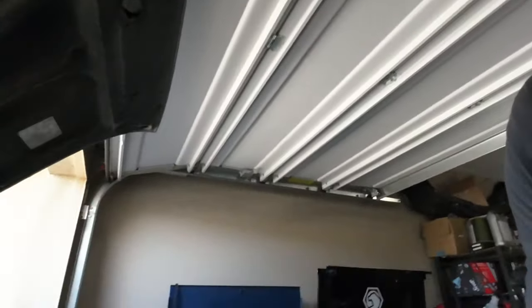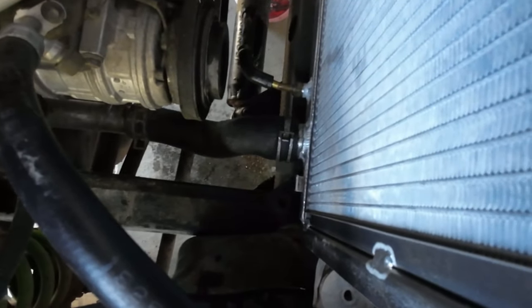After a lot of hard-fought battles and one shirt change, we got the bottom radiator hose on. If you're going to do this, I'd recommend switching to a different type of radiator hose clamp — don't use the OEM spring tension clamps, because there's not a lot of gap there. I ended up using vice grips to hold them in place and literally slide the whole thing on. We're mounted. Now it's time for the fan and fan shroud, and then we've got to put the battery back together.